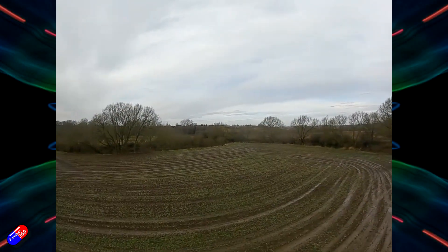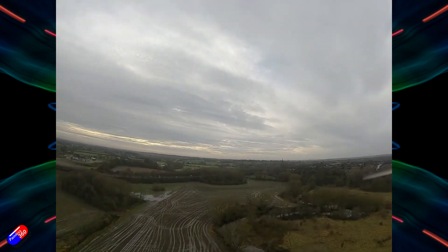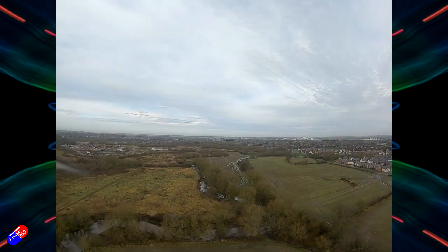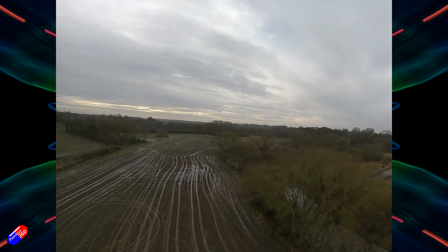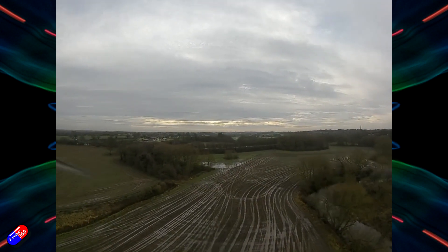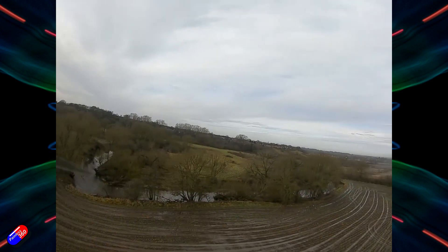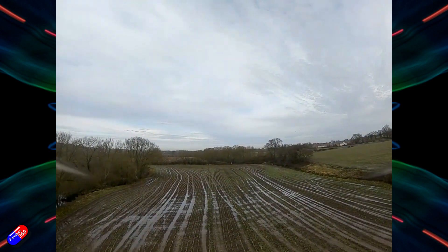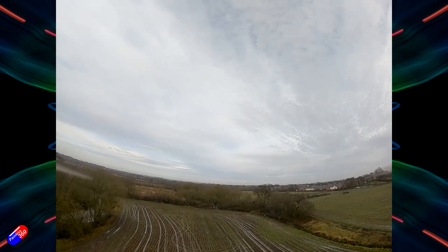In terms of the flying, there are no surprises at all. I'm getting about six minutes on an 1100mAh 6S pack that I've ended up flying this with. It is incredibly stable, thanks to those standard X slightly wider arms, and the 6S version I have here has a huge amount of power, hovering at under 25% throttle without an action camera. It is also very quick in the 6S configuration. It's probably still quite a beastie on 4S, but if you want to fly it like you stole it, the 6S is just lots and lots of fun.